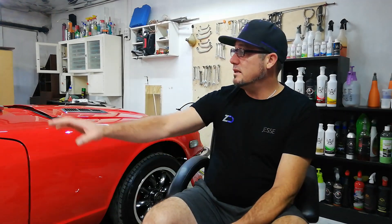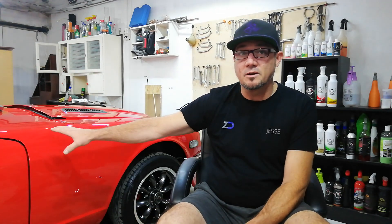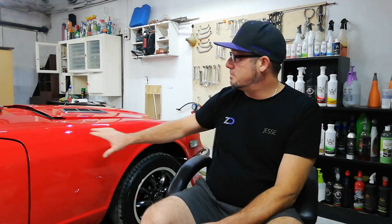If they don't know if it's pH neutral or not, don't let them put it on your car — even if you do have wax on it. These really caustic cleaners they use are basically a lorry wash or semi-truck wash. If you don't have any wax on your car, there's a really good chance it's going to damage your paint, especially in summer when your paint is hot. It's also very dangerous on metal and plastic trims. A friend of mine who worked at a car wash had the undiluted pre-wash accidentally spill on his hand, and within a split second it burned him almost up to his elbow. Even diluted at 1-in-100, 1-in-200, or 1-in-500, it's still very caustic and will damage your paint.